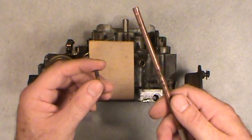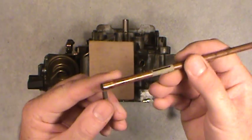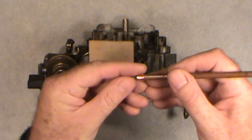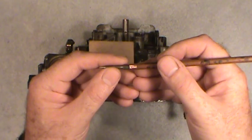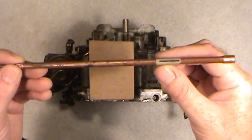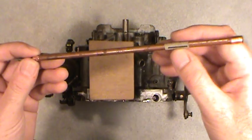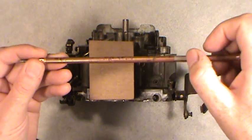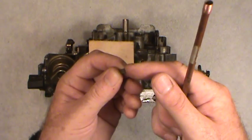I looked around my little workshop, found all kinds of scrap metal and tubing, and found this piece of copper tubing. It's a little bit flared on one end, but that's not the end I'm using. Initially it was just a nice fit on that hexagonal part of the idle mixture screw. Then I thought — if there's a little bit of slippage there I can't count my number of turns — so I also put a line on there with a felt pen so that when I turn this thing, I can count the number of turns. You can put little X's and O's or colors along there so you can actually watch how you're turning, since you can't see a screwdriver slot in the end like the older models had.